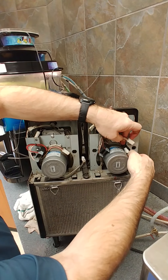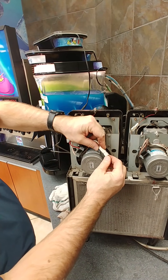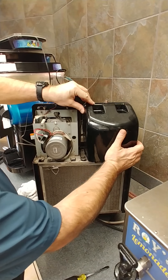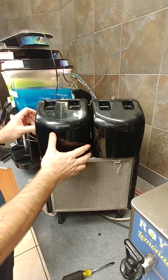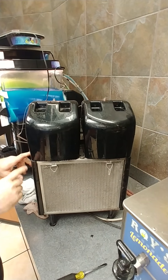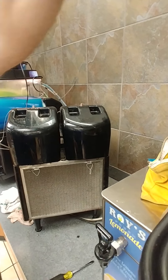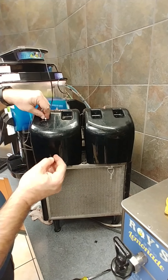Now since the screws are tight, plug the wire harness back in and tuck it back in there. Since the back of the machine is done, we can put the back covers back on it — these just snap on in the bottom, and we've got two screws to put in the top. When this is on right, it should go over the outer lip here and not on the inside of the lip. Then put the four screws in and tighten it up — that takes care of the motor service.